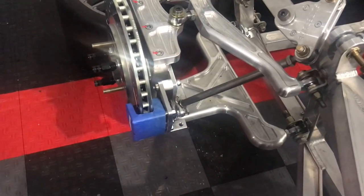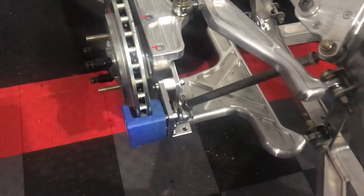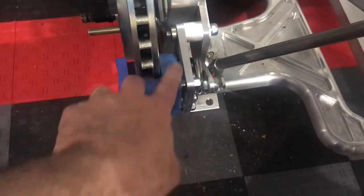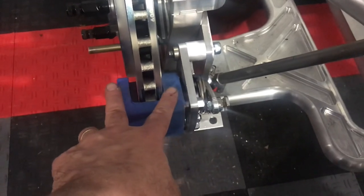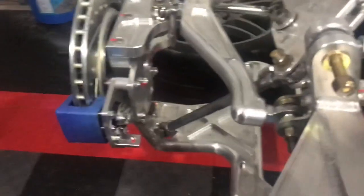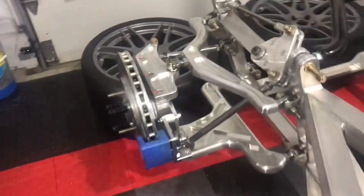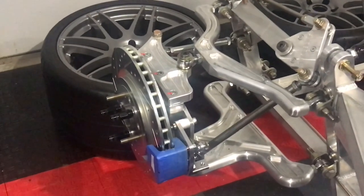That's always preferable especially when it's unsprung weight. There's also an adjustment bolt I didn't mention — when you turn it, it moves the caliper in or out. So you fab up the washer to get it really close, maybe within a tenth of an inch, then use the fine tuning to get it perfectly centered. Looking at the finished bracket mounted and torqued on the upright — I'm happy with the end result. Hopefully they do the job. As always, thanks for watching and take care.